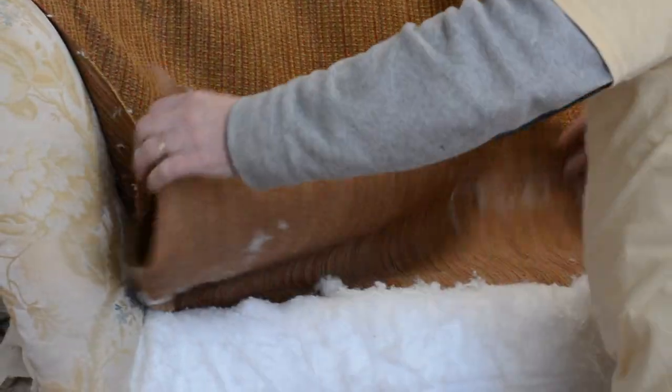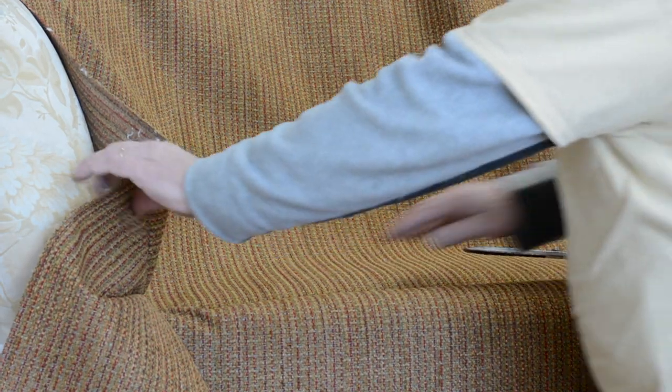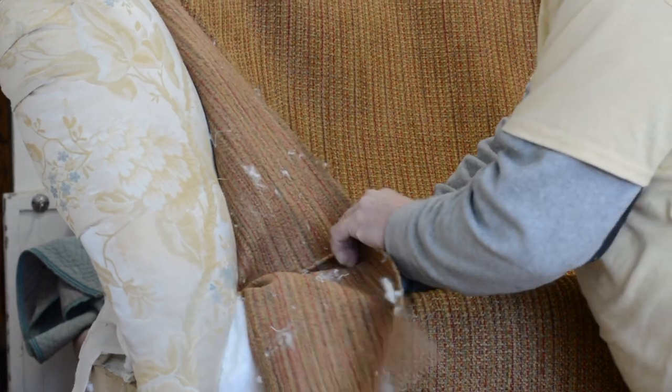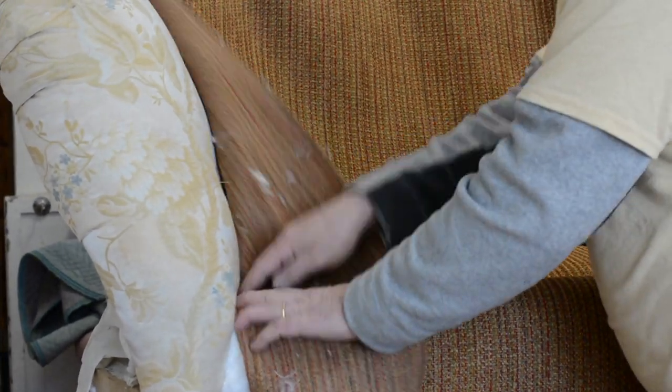Okay, the seam, and we're going to show you this in a minute. We're going to show you the seam down here has to go in between the seat and the deck, like so. But on this piece here, to bring this back this way, we have to actually make cuts in here, in the front here. We can see the cuts, I think, from that angle. And what we're going to do is fold this back. I've got my seam lined up at the bottom here, which again, I'm going to show you in a minute. And I'm going to be straight like so.